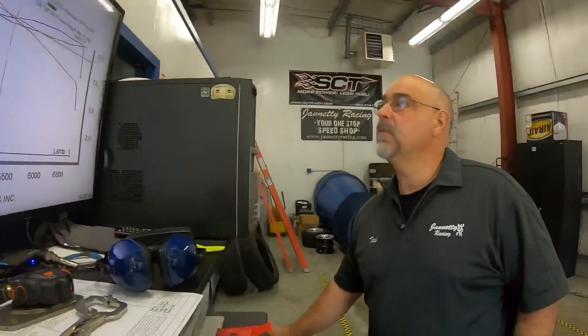It's still an amazing amount of power at the rear wheels from a car that was only rated 650 at the crank and 650 torque, so it's up quite a bit. It's impressive any way you look at it. It's a shame we didn't get baseline numbers on this, but the combination of the crappy fuel in the tank — whether it's old fuel or just bad fuel, maybe a load of 87 — we've only got E44 on top of crappy fuel and we got low boost, so with those two factors it's still making amazing power. Look at that torque curve — it just doesn't get any better than that. The car's going to be an absolute animal.